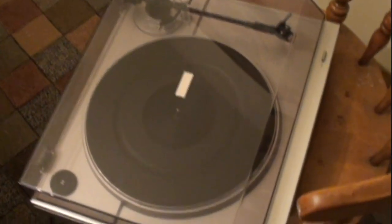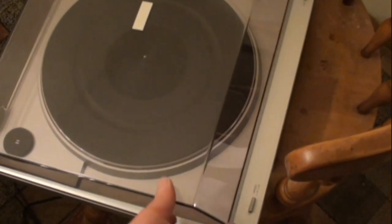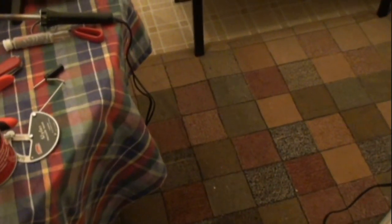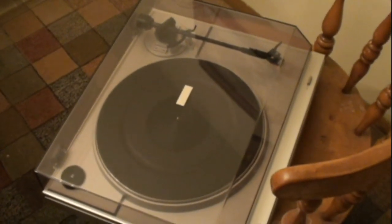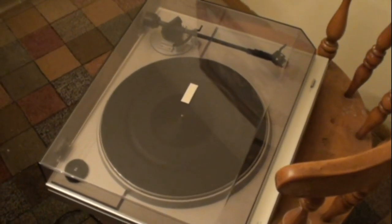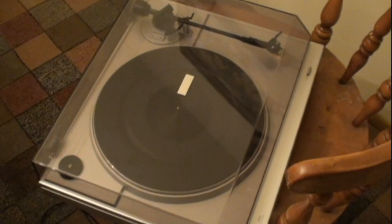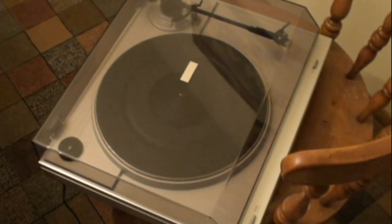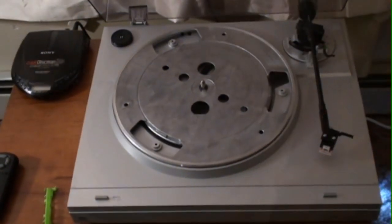Another thing I can tell you about, as far as reconditioning a hazy, scratched up cover like this, I just use some of this kind of plastic polish. You can get various kinds of this at an automotive store. Same principle as if you've ever had to polish your headlight lenses on your car to remove that yellowing or haze or scratches. And as far as the audio plugs, I just use some of this kind of contact cleaner to recondition those so I know I'm getting a really good signal to the amplifier.